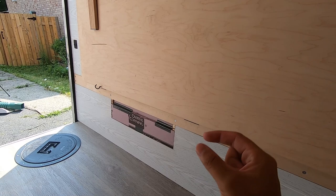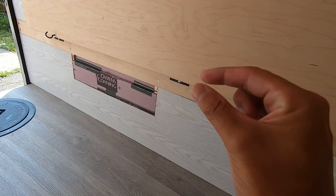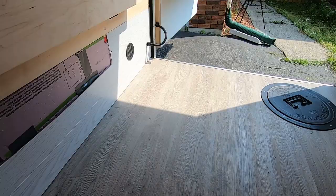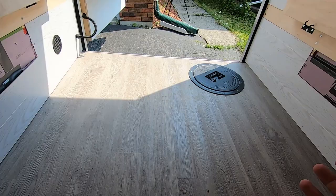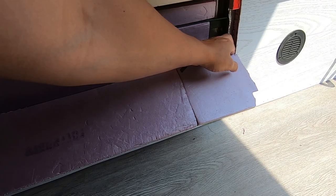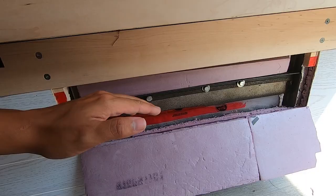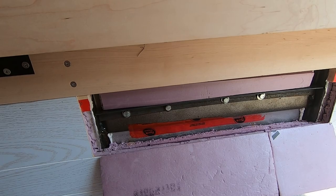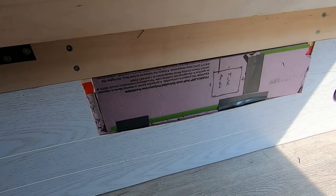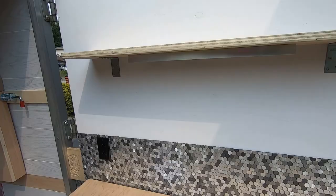Because you're working with such a small space, the thickness of every material you choose really greatly impacts interior space. If I were to do it again, I'd choose something slightly more durable and a little bit thicker for peace of mind about not bumping into the wall and puncturing it. The third thing I would do differently relates to two exposed openings — these holes in the wall. I custom fabricated fenders because I upgraded the wheels, and we had to install a plate on the inside to support the upper half of the fender. Because I already had the walls finished, I had to cut open a hole. This could have simply been avoided if I had just installed the fenders before I finished my walls.